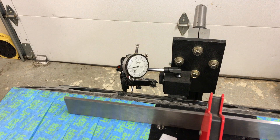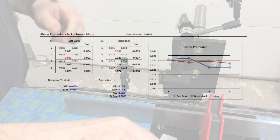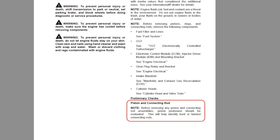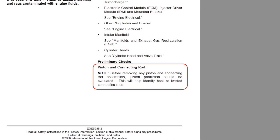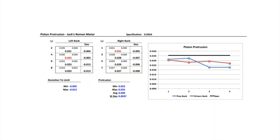I won't show all the segments, but I ended up doing this three times. This is the reason for the multiple measurements — there was what I thought was a lot of variation, and that's not good, as variation usually means you have bent connecting rods. And who knows what this company used for connecting rods or how they checked them. So this brought this project to a halt, because I'm not pouring a lot of money into this already rusting, clear coat peeling truck after what I've already spent.